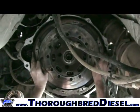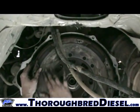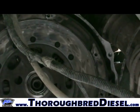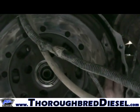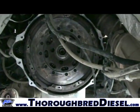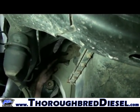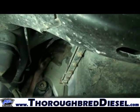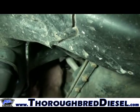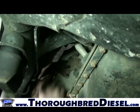You can see the glazing on this clutch where it's already starting to slip, and heat marks on the pressure plate. This is the dual mass flywheel — the problem child. You can see heat spots on the grabbing surface where the clutch has been slipping. To get to the crank bolts, we need to disassemble the dual mass flywheel. On the backside of the engine there's an inspection plate held on by two 10mm metric bolts. Loosen the top one about two turns and the bottom one fully, which lets the inspection window swing around. You'll see two holes — one for the barring tool and one to access the bolts.